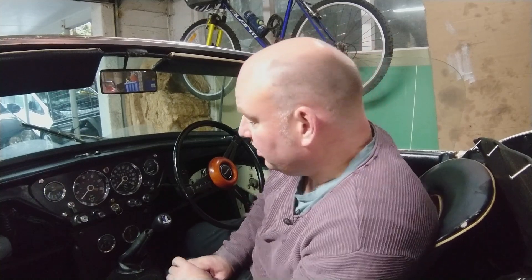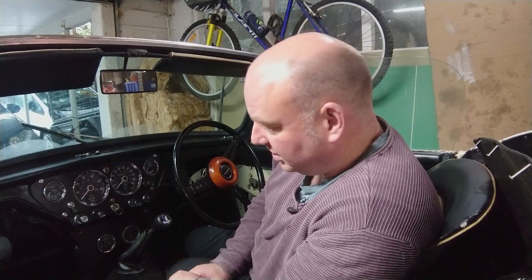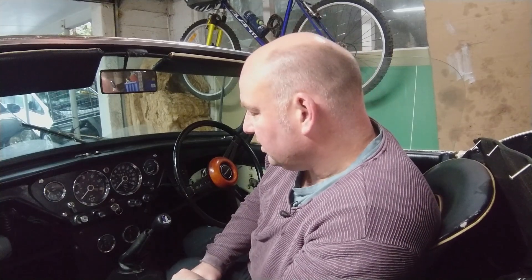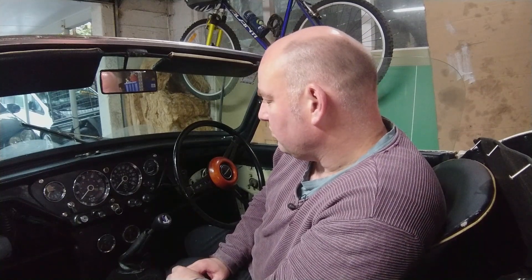Hi everybody, I'm James and this is my Spitfire. I thought I'd start off today's video showing you a few things I've been getting up to off-camera. It's mainly been sorting out all the wiring in the car — it was a complete mess. People who obviously had no access to the proper wiring diagram, or really knew what they were doing, had tried to keep the car going in the past. What I've done is restore all the wiring to how it was when it left the factory, other than a few connector blocks which I still want to replace with inline splices.